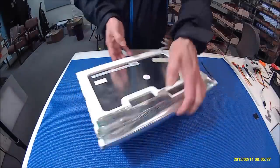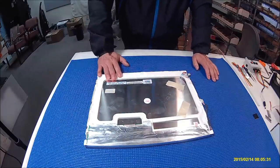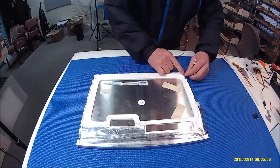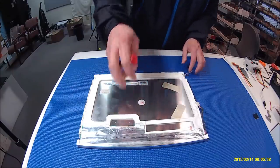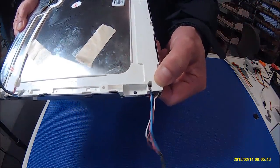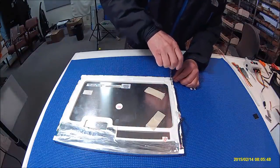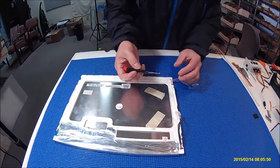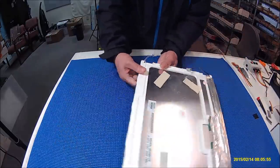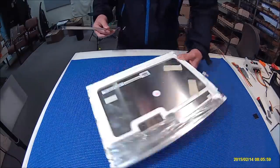It's quite easy to replace the lamp on this particular screen, so we don't have to disassemble the whole thing. Basically, you just remove this wire here, and then there's a screw here inside. I'm going to just take it out — it's one tiny one. Set it aside, just grab it and pull it out.